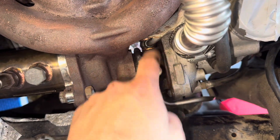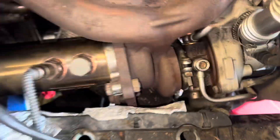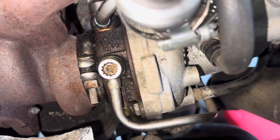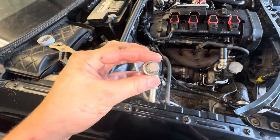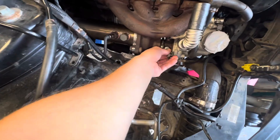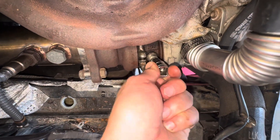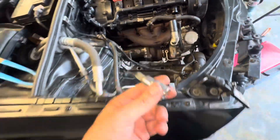When we go to the top, you can see it again. We're going to take it off up top — it's a spline bolt and it looks almost like it's stripping out a little bit. I've got an M12 triple square bit, or spline as I call it. You can see it goes in there with no play, so that's what you want — we're going to be using an M12.